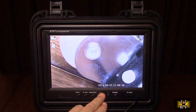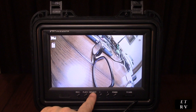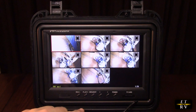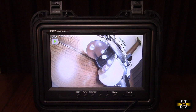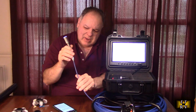If you want to zoom in on an image you can hit that button to zoom in for a really close view, then zoom back out to the default position. To view videos, go to the menu, move across to the video symbol, hit record-minus, scroll through the various videos with the button, and hit record-minus again to play. You can also remove the TF card, power down, put it on a computer, and read the files that way.